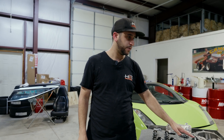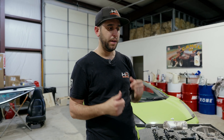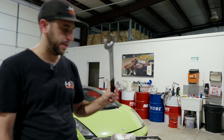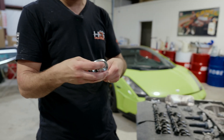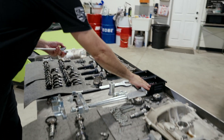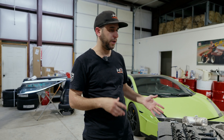If you're wanting to do this at home, there are quite a few special tools. These valve covers are cam caps and they hold the camshafts in, so when you pull those off you've got to use special tools to hold those cams in place. Once that's off, you still have to remove the cams using a special 39-millimeter wrench that goes in there to hold one side of the nut while you pull the cam bolt off. Special tools I can't find anywhere else — only Porsche. Even something as simple as locking the crankshaft in time requires two separate little tools, only from Porsche. If you're going to do this job at home, expect to pay around $2,000 minimum on specialty tools.